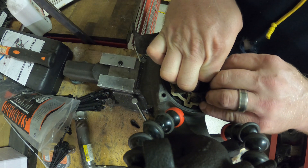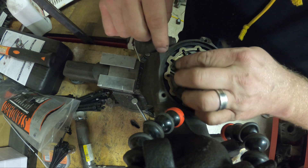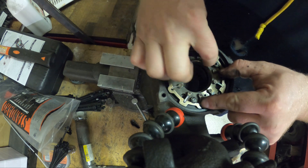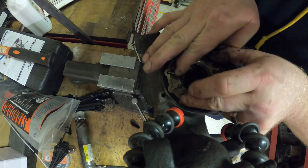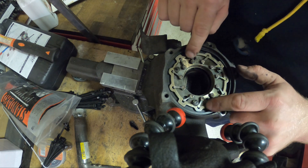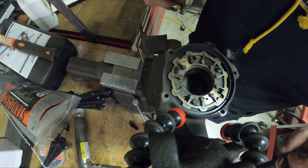Just take him out. There are two in place. Now all of them are in a ring and this can slide around — it's just a matter of some of them hooking, so put a little pressure on it, start moving it, and eventually you'll be able to push. This whole side is done and I can just work my way around — a tiny bit of pressure, slide each dog bone into its spot. There you go — they're all there. Everything moves freely; you can see the vanes poke out and go the other way. Now all we need to do is make sure this is lined up with that dot, put our top on, and everything should operate just fine.